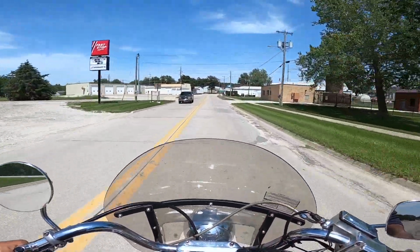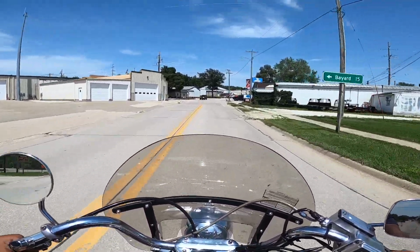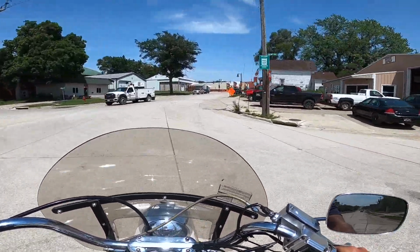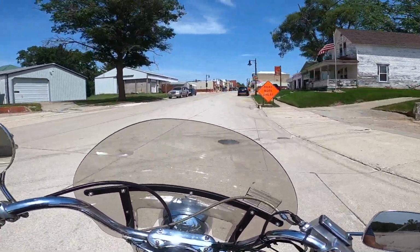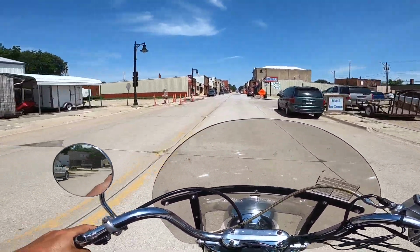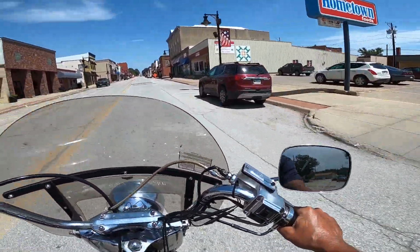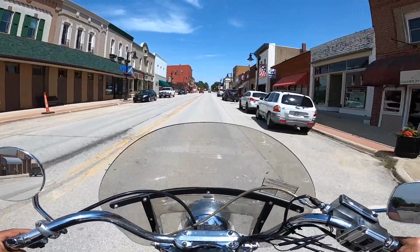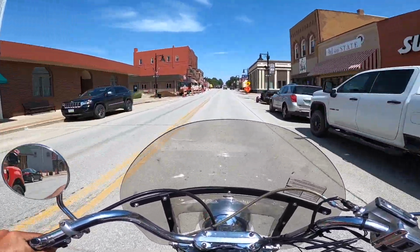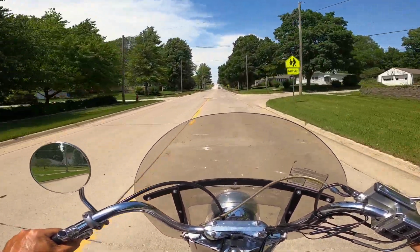It's got a rigid rear suspension, and the seat is on a pogo stick, so that's your whole rear suspension. The front suspension, it's a Hydra Glide, so it's forks, but I think they're very limited. I would be amazed if there's more than a couple inches of travel. When you are riding down the highway, you learn to look for bumps. Within the first couple miles, I learned to identify any kind of obstacle at all. The front, when you hit certain bumps, will shudder on you.